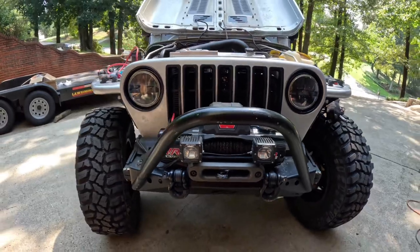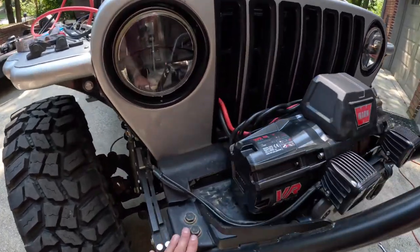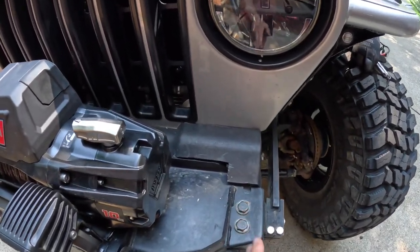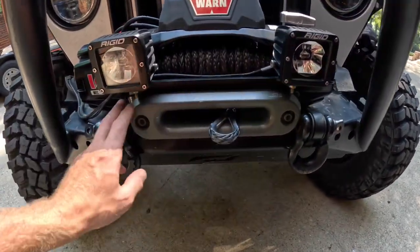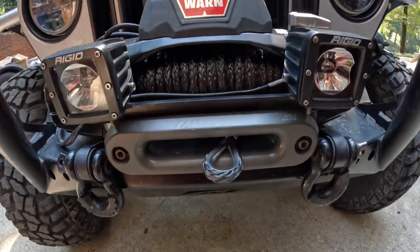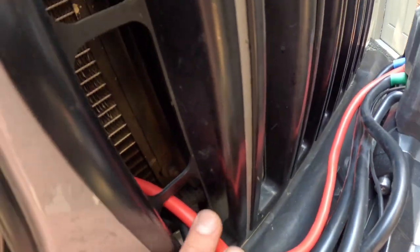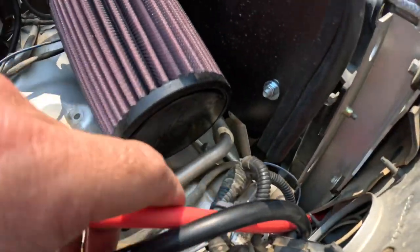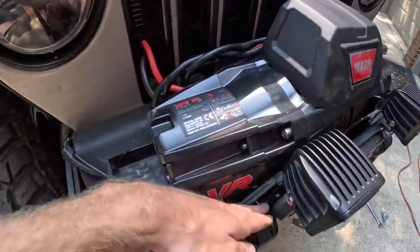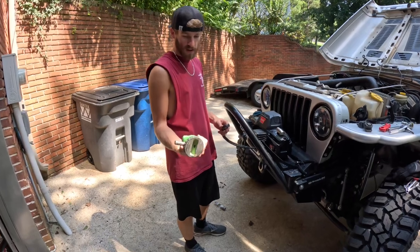It's a first look at the new winch. It's a lot easier doing this with two people, but we got the bumper back on and got all the bolts snugged up again — these are 19mm, but on a stock bumper they'll be T55 Torx. He was able to keep his pods and reused the Factor 55 fairlead instead of the new Warn one, just for aesthetics — kind of a cool color. We fished the wires through the last little opening in the grill right where the old ones were, and then we'll zip-tie and clean all this up heading back to the battery.